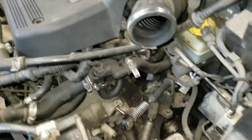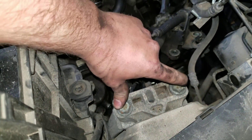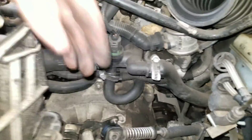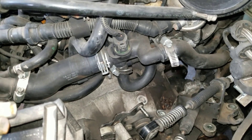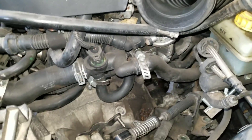We're getting close to pulling this thing out. Next I'll remove the bolts for the transmission mount and all the bell housing bolts up top — I believe those are 17s, 18s, or possibly 19s. Then we'll go under the car, support the engine, remove the dog bone and the remaining bell housing bolts, pull the starter out, and we should be able to wiggle this thing out of here.